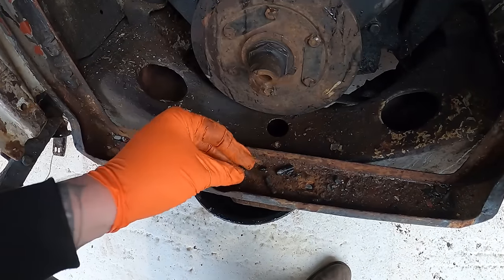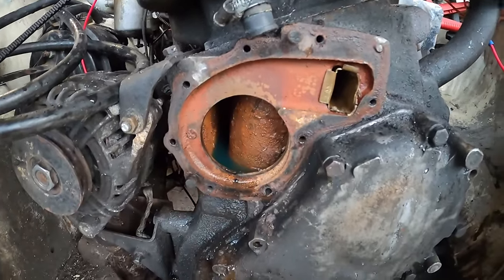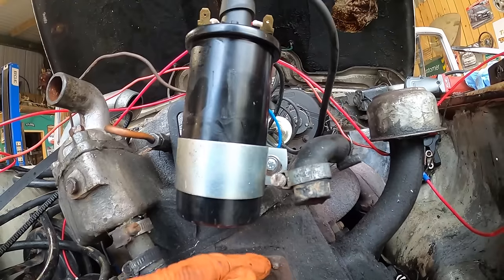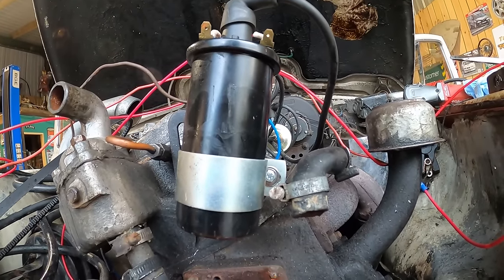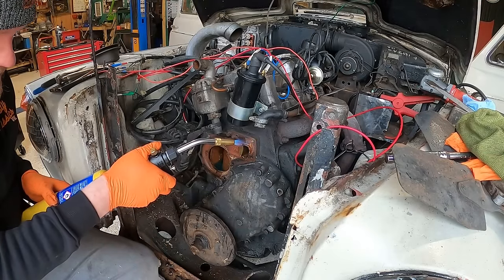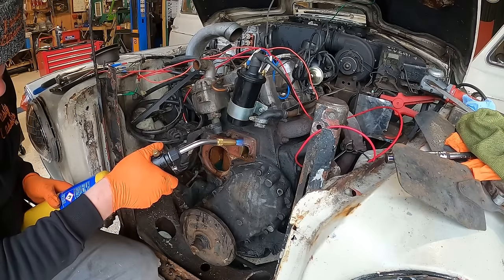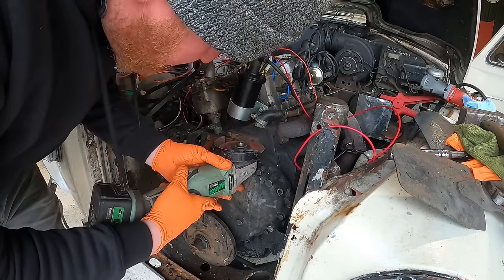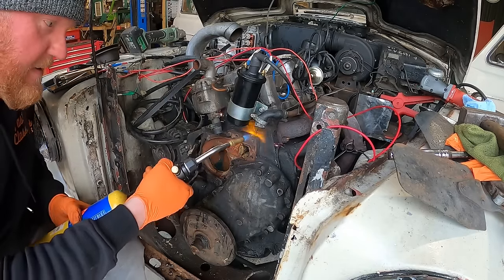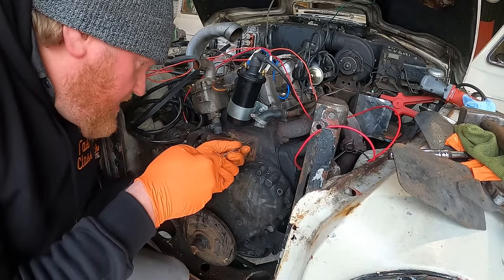No drill so far, and I've managed to get three of these studs out, which is great. Fantastic. Just using heat and mole grips. Now this one, I'm going to try and heat the area and then tap it round with a screwdriver and then see if that'll move it. Sorry, I wasn't focusing. This one here. I've put a little slot in it for a flathead screwdriver, hopefully. Right, let's get proper purchase in there.